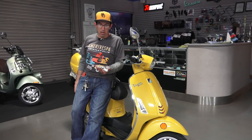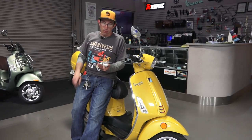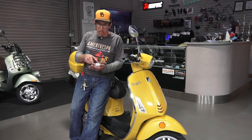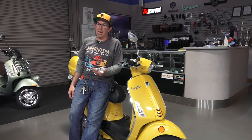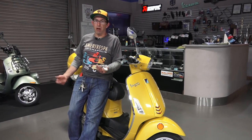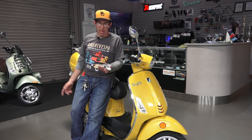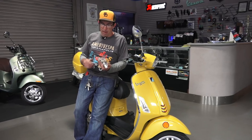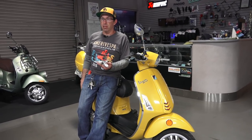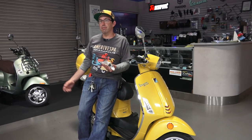Sometimes the ballast is too large. Many of them, the H4 mounting base is made of plastic that's too thick and ends up being much too hard to install in the headlight reflector. And even many of them have just been downright poor quality — I'm talking use it for a week and find out it's burned out or lost the low beam. That's no good. Not a product we want to sell.